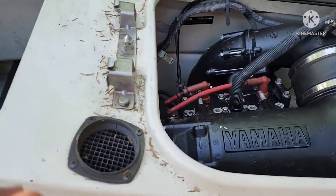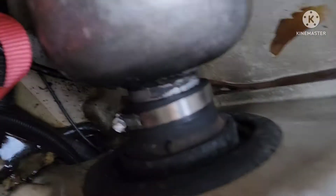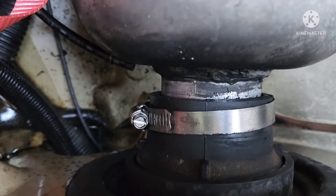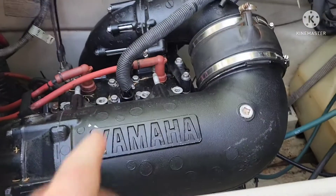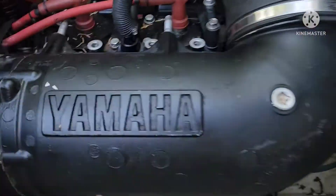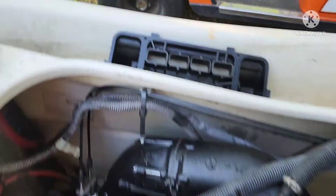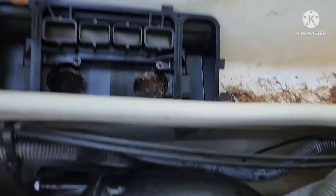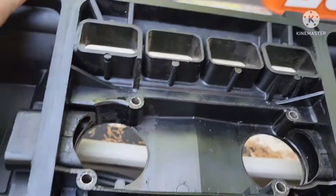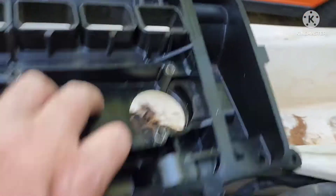You've got to remove that hose, and then this whole exhaust will come out this way and up and out. I did forget to mention there is one five-sixteenths nut right there that you have to take loose on the exhaust. Some people pull that strap to slide the exhaust back off of that boot — however you want to do it — then that whole piece will remove, come up and out. I find it much easier to take the box off, which uses 10 millimeter bolts.